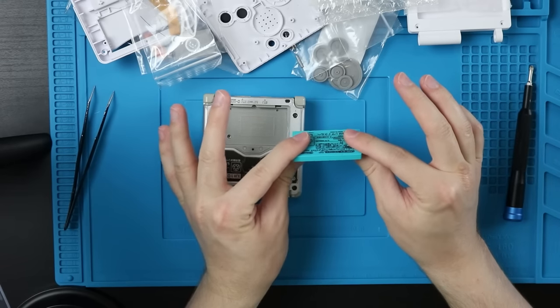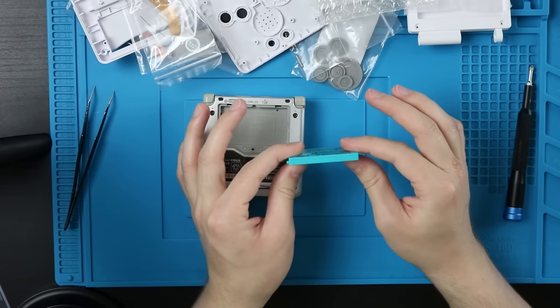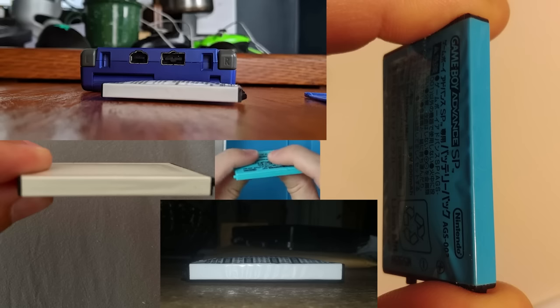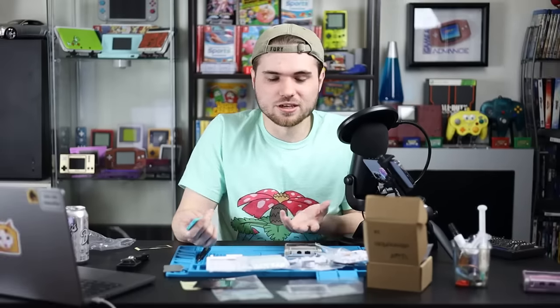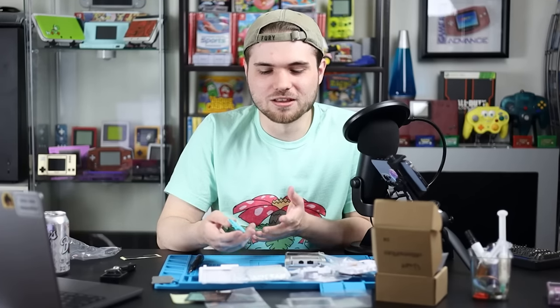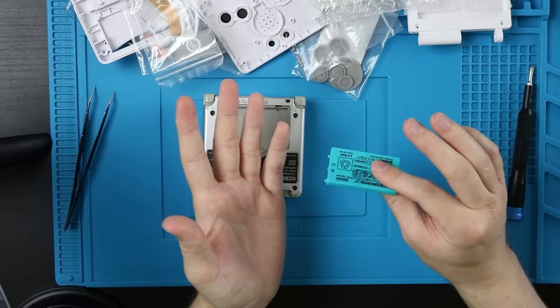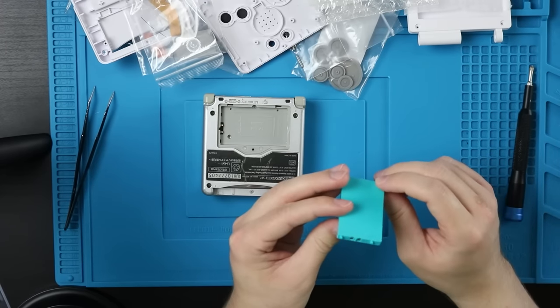This little tab right here, you can stick your fingernail under and bring out the battery. Since this is an actual battery instead of double-A batteries, on your old console, take a look at the battery and if it's puffy at all, throw it out — safely. But if there is any puff to this battery, toss it and get a new one. I'll link one down below. They're generic batteries, so they could be good or bad. I've had good luck with these ones, but they're probably lying about how long the battery lasts. This one has no signs of damage whatsoever — it honestly looks brand new, so we're gonna reuse this.